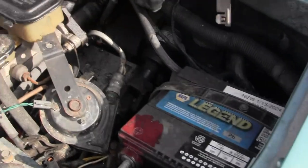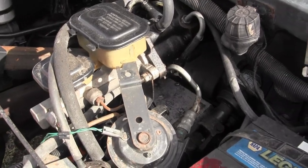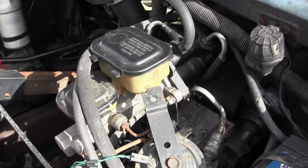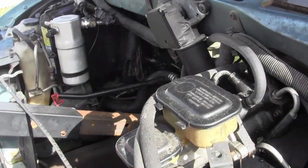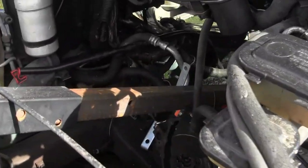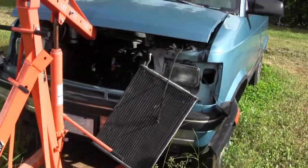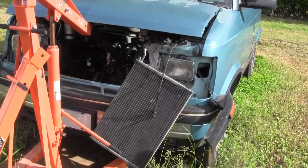The battery failed in January of this year. I changed the master cylinder and repaired the hydro boost — it had a leaking seal and it took me three tries before I got that right because I didn't have the right size seal. I had the AC working but had to take that apart to get the engine out. I'm ready to yank the engine and send it back to Powertrain. I hate to give up that block because it's a virgin block — the original factory crosshatch is still there on all six cylinders and there's no ridge.